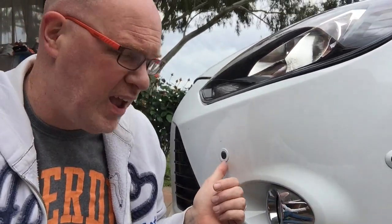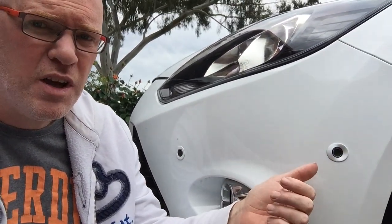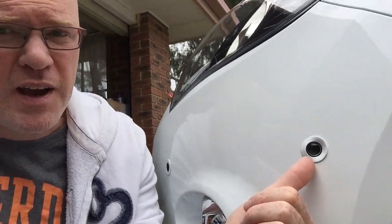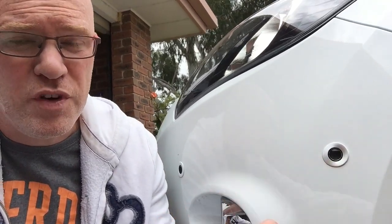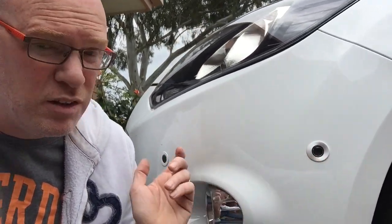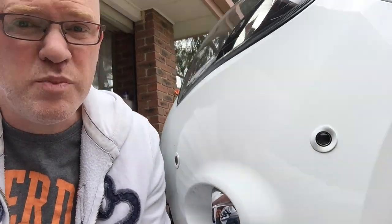One of the things I had to do was give the car vision. The car already had ultrasonic systems in it. What I did was rip those out and replace them with 150-degree camera lenses to give the car vision. They actually fit perfectly in the spot, so it looks quite nice and tidy. They are black dots now rather than white ones, but it worked quite fine.